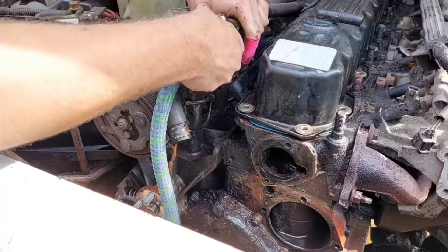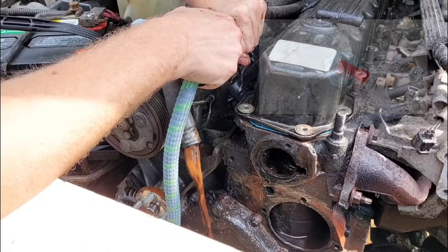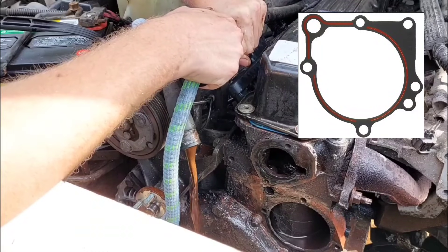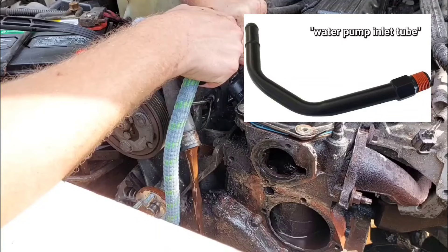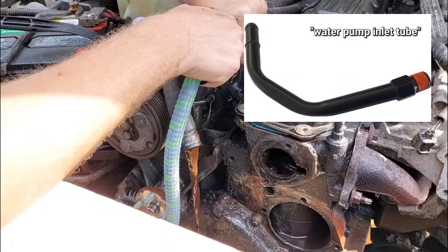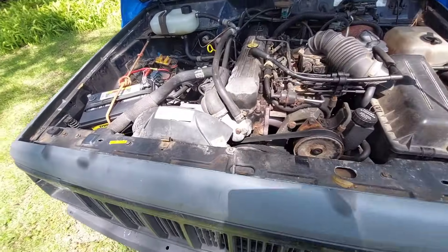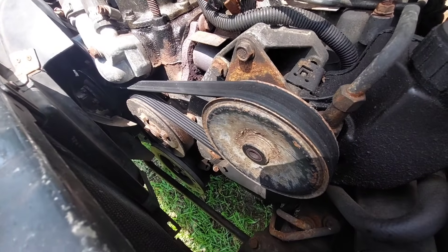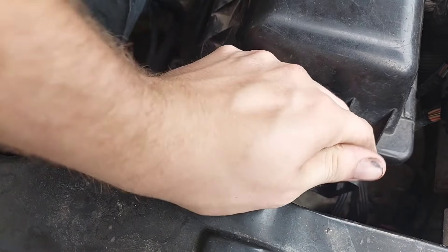In this video I'll be installing a port we can use to more easily flush the cooling system in the future, as well as a new radiator cap. You don't have to do either of those in a normal water pump replacement. The only thing you'll need is a new gasket, and optionally the metal pipe, which is commonly difficult to remove and not included with a new water pump. Note that earlier engines from 1987 to 1996 used a different belt routing and tensioner, and old Renix Jeeps have a closed-loop cooling system, so the process varies a little on older ones.